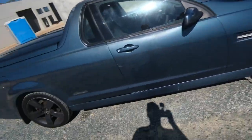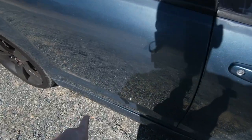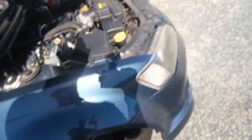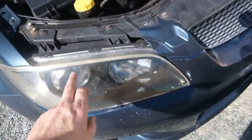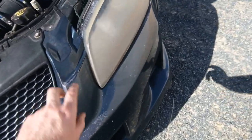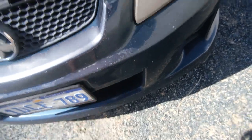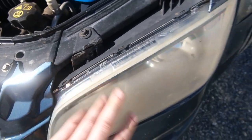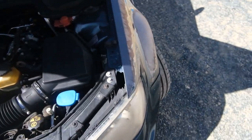It's got the badge missing there — it fell off actually. On the inside there are scratches. The headlight's going to need reconditioning. The front bumper is cooked — split here with all the stress fractures — so I need a new front bumper. This headlight's been repaired before so we'll re-repair and recondition that. The bonnet's just got a little bump there.